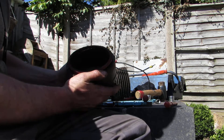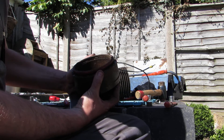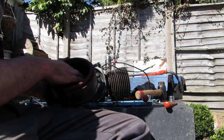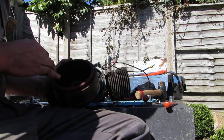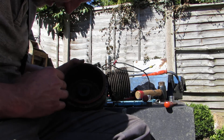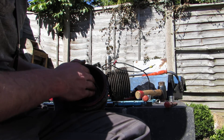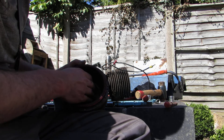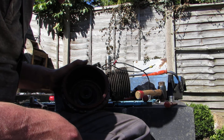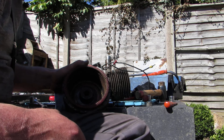Other than that, the windings look tidy enough. Commutator showing very little wear - might be the one I end up using. That commutator at the back there on the first one I pulled off is worn right down, but that engine, assuming it is the original engine to the car, has done 40,000 miles - quite a lot on a small machine. So that armature has potential.